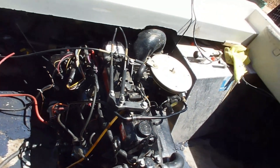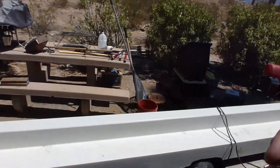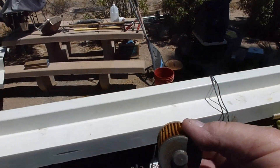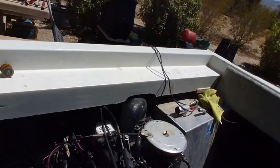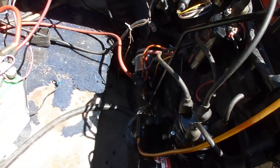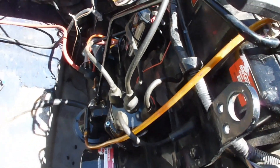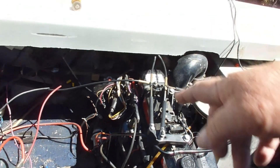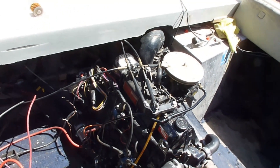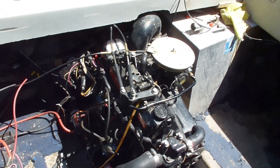Then the starter went out, so I got a new starter. The fuel pump was also having problems — I pulled it apart and it looked like it hadn't been touched since it was new. I found debris in the bottom when I replaced the filter, and fuel was coming up the wrong line, so I replaced the fuel pump — another $35. I also switched from points to electronic ignition and got a three-ohm high-output coil. Now I'm waiting on plug wires because these are all dry rotted, which I think could be my problem.